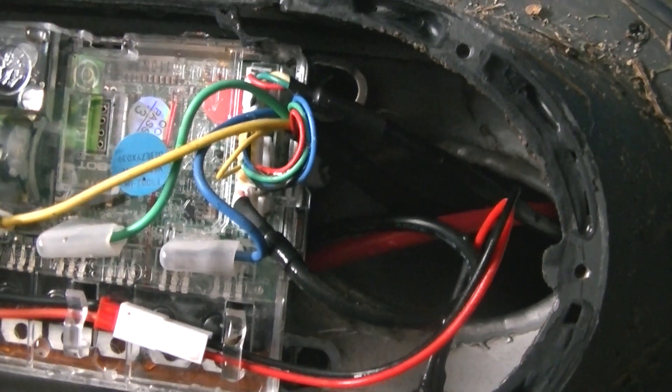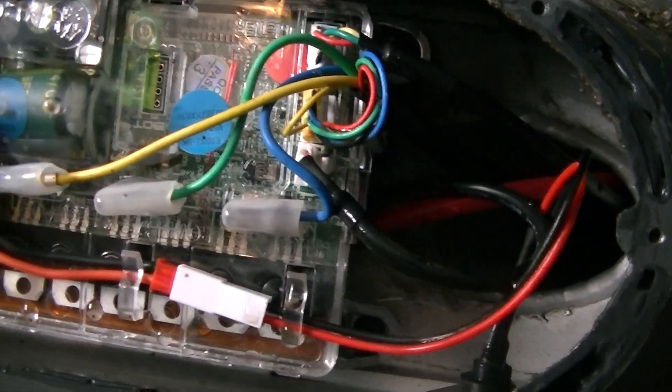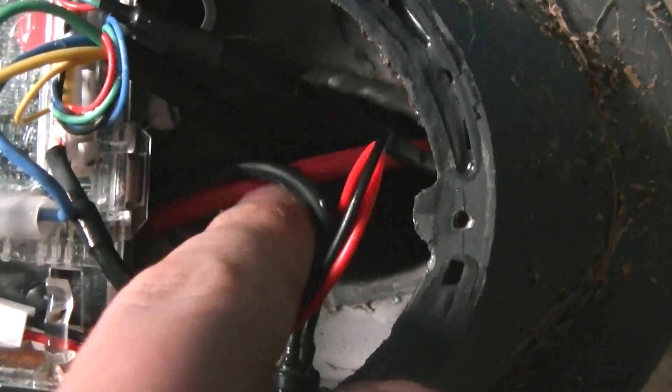Actually, it wasn't even sitting outside the store — I was carrying the thing, but it probably spent about 15 to 20 minutes in the slight rain we had. I haven't gone through any deep puddles or anything like that. I suspect the problem is water's coming through here. You can see this wire going to the speed controller is wet. The plugs on the speed controller are wet, and the outside of the speed controller is wet.